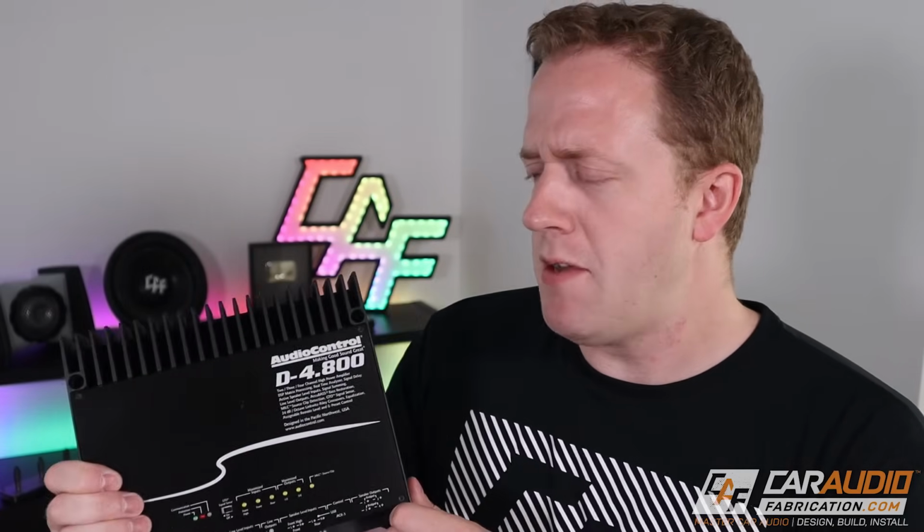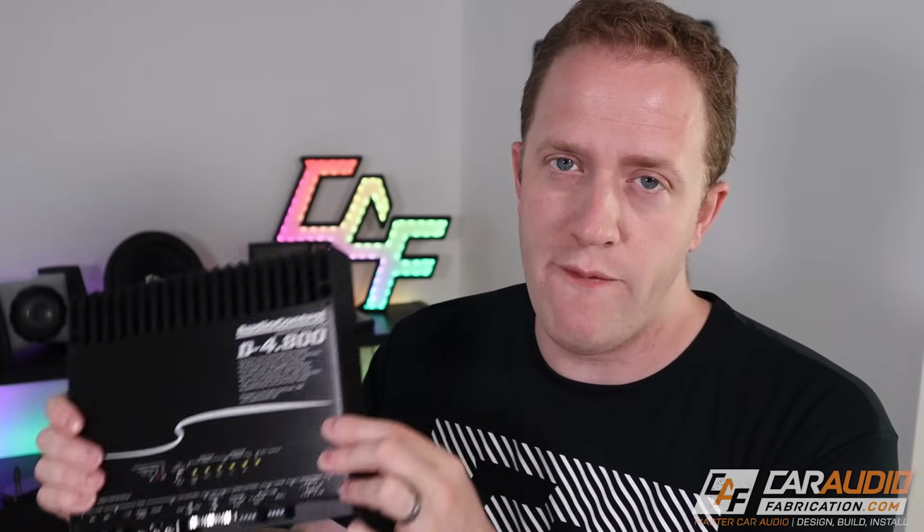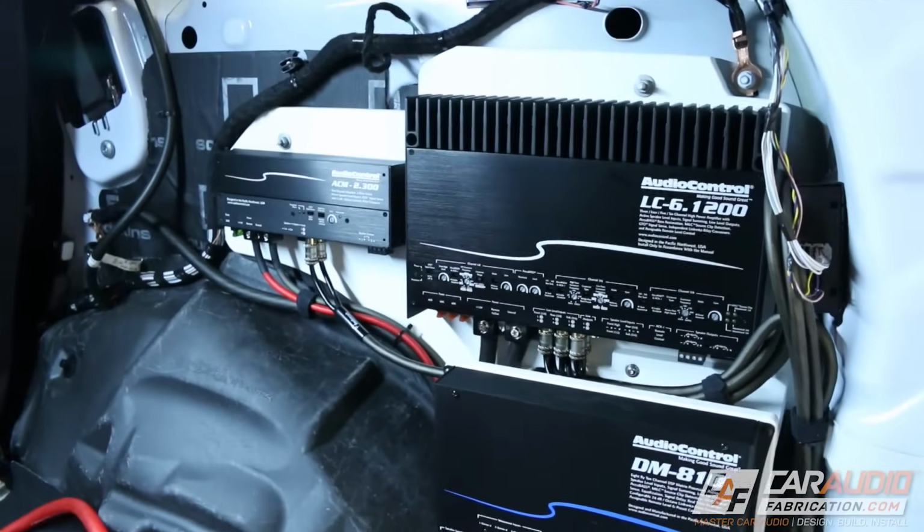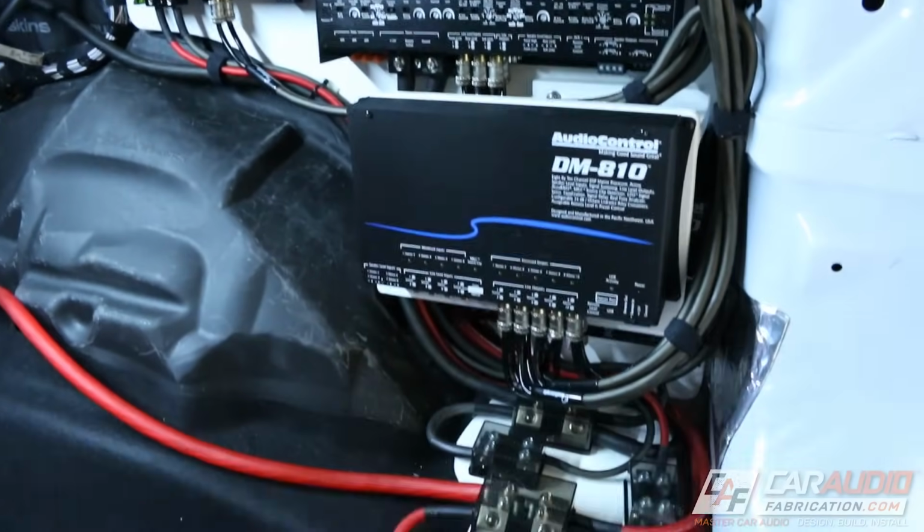Another issue that comes up that we see from time to time, and this depends on your amplifier model, but some amplifiers, if the metal casing is actually touching the ground of the vehicle, it can also create a sort of ground loop noise. I usually try to isolate the amplifier from the metal of the vehicle by making a plastic amplifier rack or amplifier board, but what if you're using a welded metal amp rack?